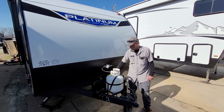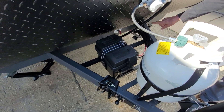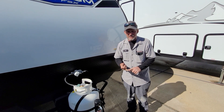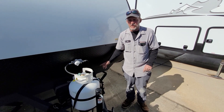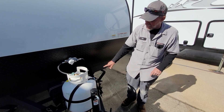Hi, I'm going to give you a show and tell. It has one 12-volt battery on the front of the trailer. While we're standing here, it does have a battery disconnect because the LP detector, the TV booster, and the refrigerator are all pulled from the battery 24-7. That's why they give you the battery disconnect. If you don't want those appliances pulling from your battery when you're not using it, you can turn the key to the off position and pull it out.